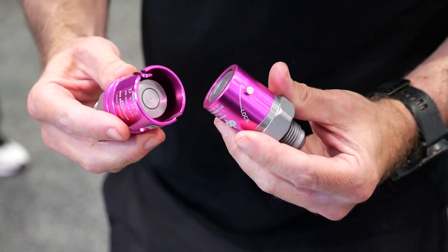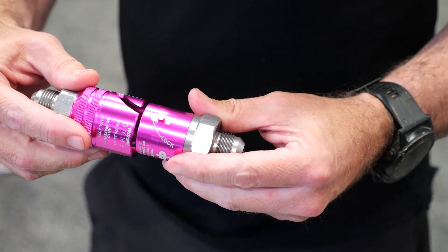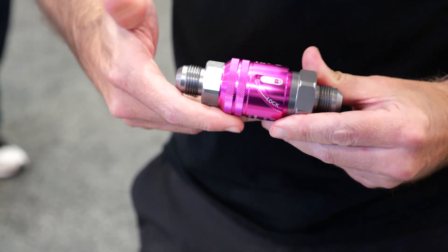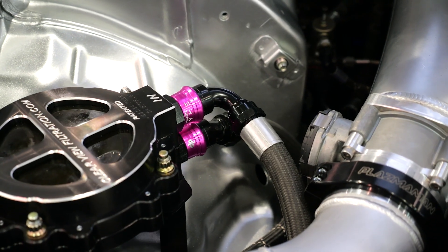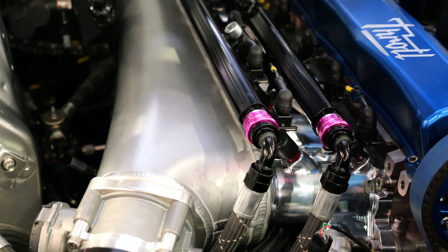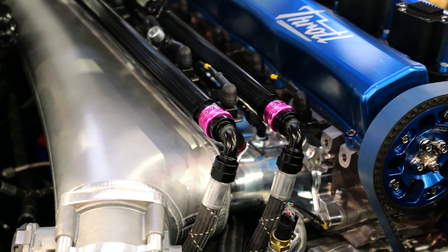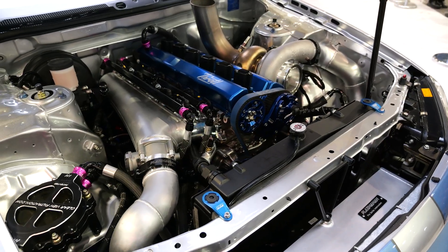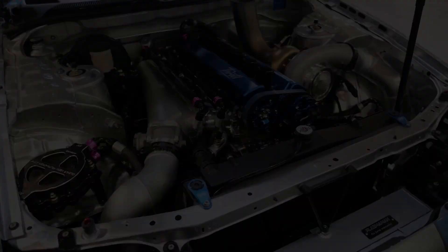Another option that Dime offer is their dry brake fitting. Dry brake fittings themselves aren't particularly new, but these allow you to disconnect a fuel or hydraulic line without introducing air into the system and without leaking any fluid. This is nice when you're removing oil lines from an engine or gearbox, but they're more normally used on systems such as the braking or clutch, where you can disconnect and reconnect the clutch line without needing to rebleed it, because you're not introducing any air into the line.